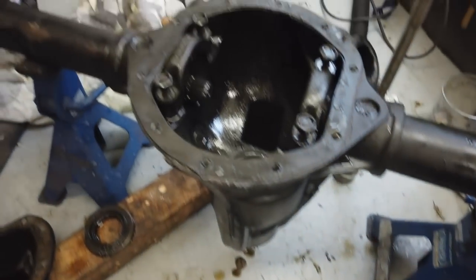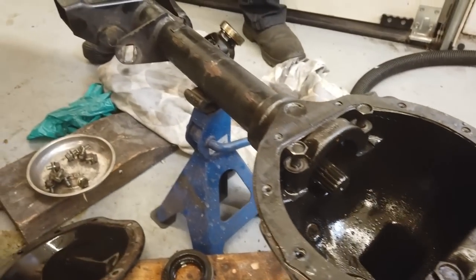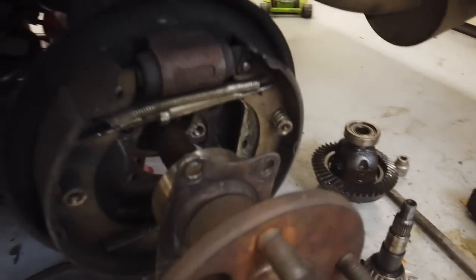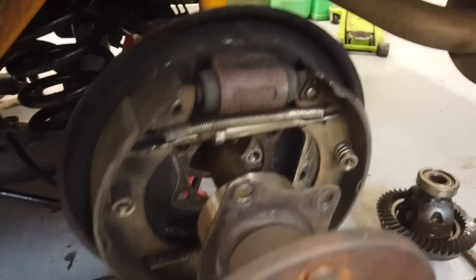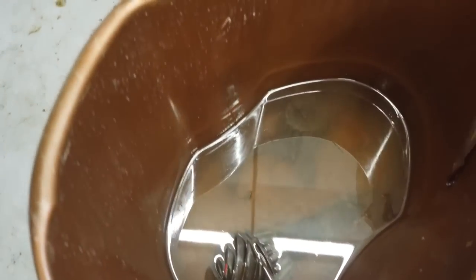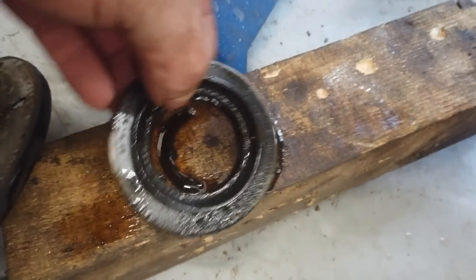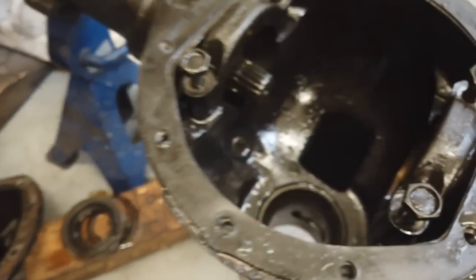We have found someone on Facebook which we think can rebuild this. Very difficult to find an axle rebuilder. So Ruby's original axle will be sent away and get properly rebuilt. And when that comes back, take this one off, rebuild this one as a backup axle for the fleet and put it into stores with oil in it to stop it from seizing, and back to square one. So that race is knocked out. This pinion can be cleaned up and reinserted. Ruby's pinion seal was knackered, which is why Ruby wept oil, so that needed doing anyway. So we've not actually lost anything, we've just learnt a lot, which is good.